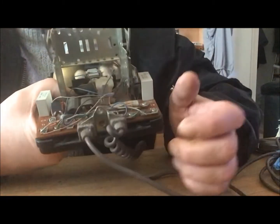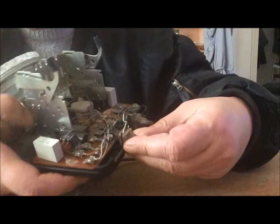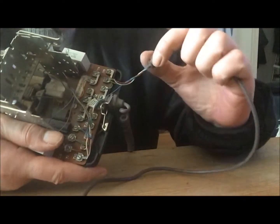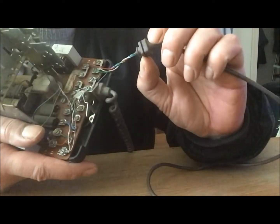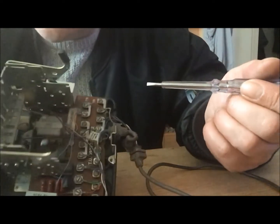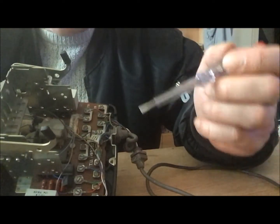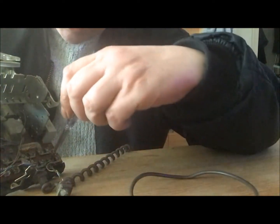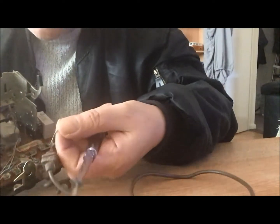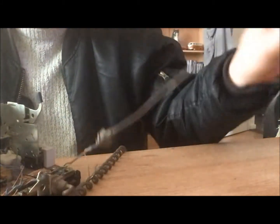The first thing we need to do is simply remove the wiring. As you can see there, just look at the grommets - take it out. With the grommet removed it just looks a lot clearer. Everything connected to the original lead is all around this area, so we're going to remove all of these. With a simple screwdriver, turn them about a turn and a half anti-clockwise - that releases the hooks. You'll see the little horseshoe wire there, and you do that with all the others connected to the old lead.